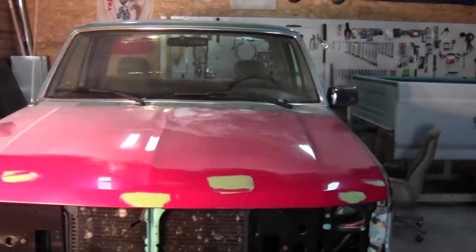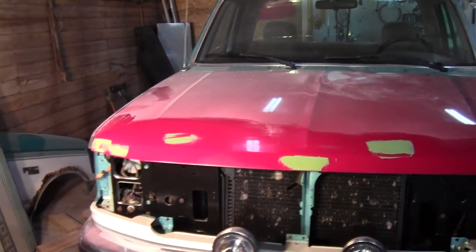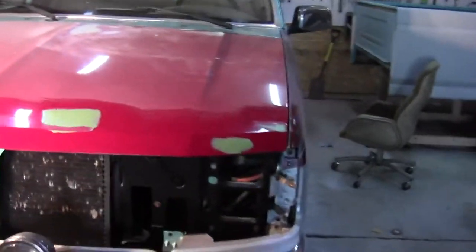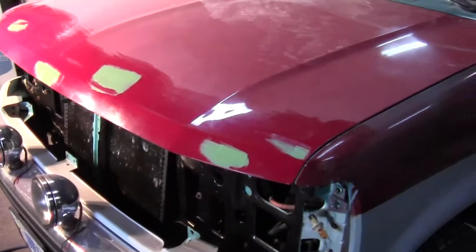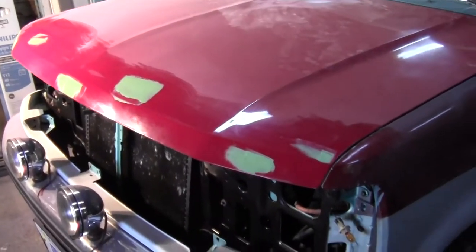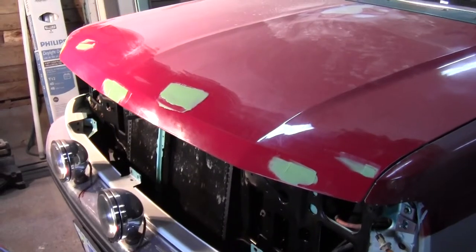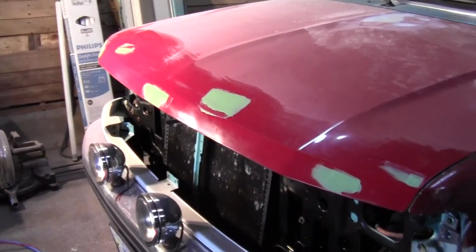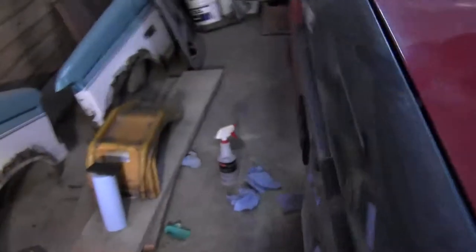We're at it again, getting close. Had a few little spots on the hood — very minor. I just hit them with the DA sander real quick. I didn't think I even needed to put any filler on them, but I did anyway just to make sure they get leveled out. The hood came off a truck painted red, and they had a hood shield on it. They put too-long screws in, which pushed the metal up just a little bit. When I sanded it, it leveled out. One or two spots had cracked clear coat, so I sanded it down and slapped some filler on there. I'm going to put a hood shield on it too, so it'll all be covered up.